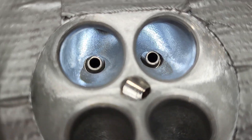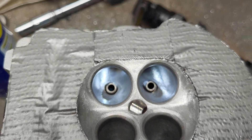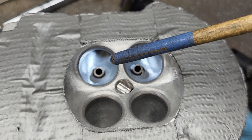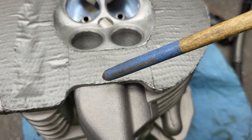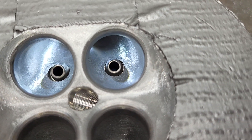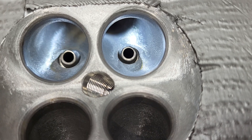What I did to one port was different than the other port. We're coming in straight here and trying to initiate a little bit of swirl — doesn't have to be a lot, but it would be nice to get a decent speed. It's going to be tough to do on a four-valve design, kind of like DV's polyquad. If it was still swirling and came out it would work with this curved exhaust. That intake port is actually quite a bit different than this one, and my smallest burr still can't get right to that very little edge.